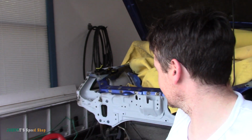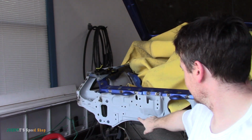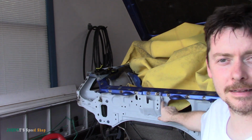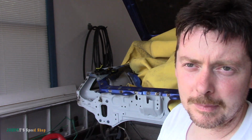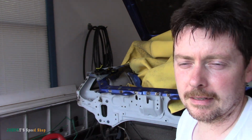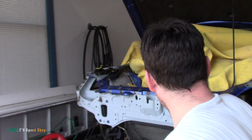That's it. Welding the inner fender, front panel, all the little brackets. I had to weld this onto the front panel. So you can barely tell I was there. And before I paint this blue, I'll put a little body filler over each spot weld and sand it back. And you just won't be able to tell. And I'm actually going to do it with every spot weld, so it takes a lot of time.